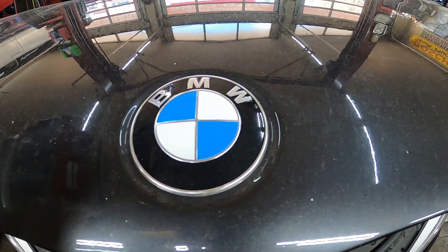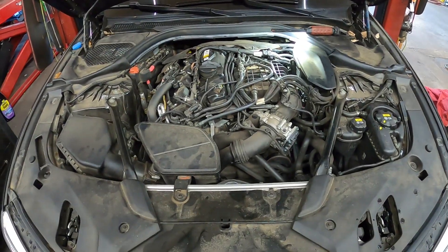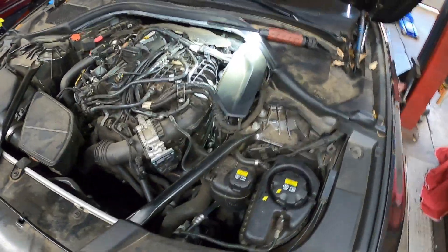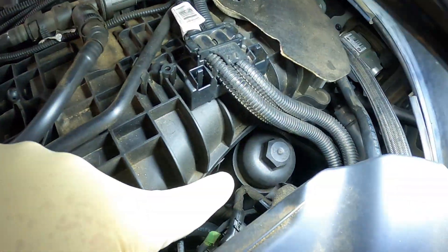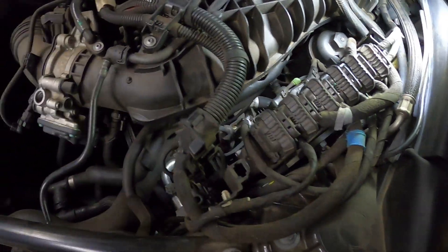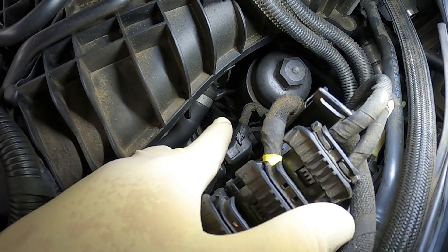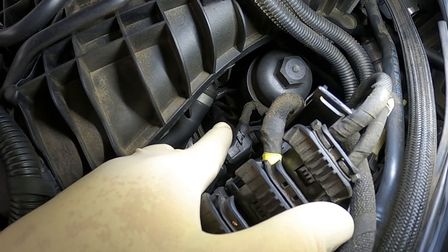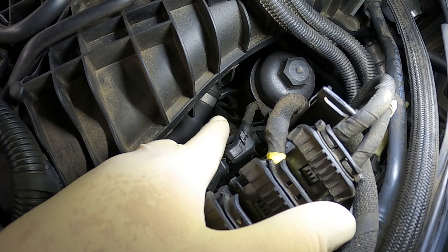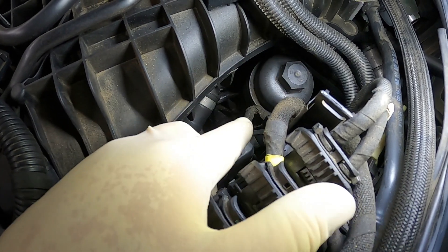Today I've got a 2017 BMW 530i with the two-liter four-cylinder turbocharged engine. We have a coolant leak at the top of the oil filter right there. I can pull this out — there's the computer. The oil filter/oil cooler housings are made of plastic and metal, basically plastic. This is the second one I've seen do this, so I believe the plastic has failed and water is pouring out. There's nothing else over here besides that.